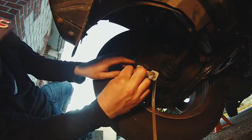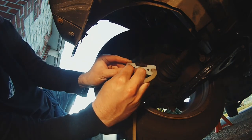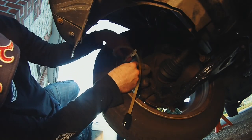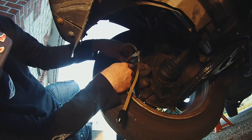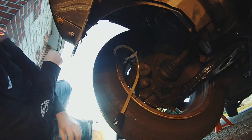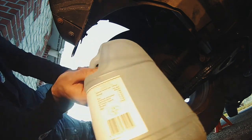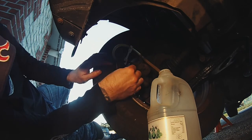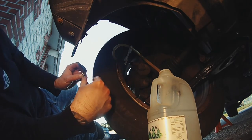Pipe goes on to the nipple again. When you shop for a pipe, make sure it's one-way valve, because when you're pumping with no assistance, which sounds really dodgy, as in no one's at both ends, you need a one-way valve, which I've got here now. You really do need that, because you'll draw in air through the nipple.